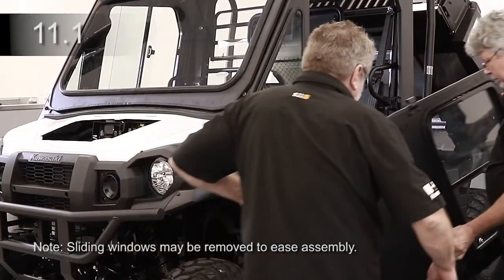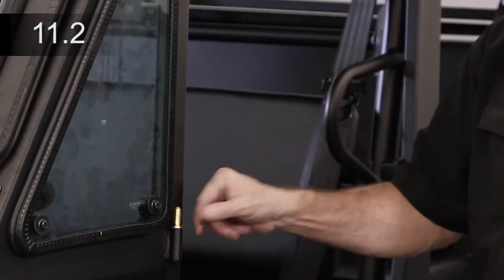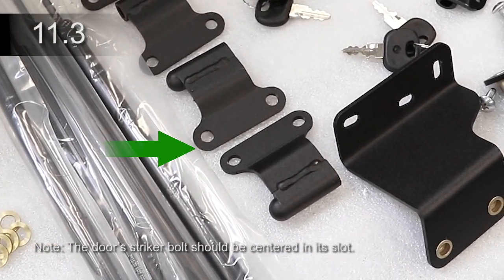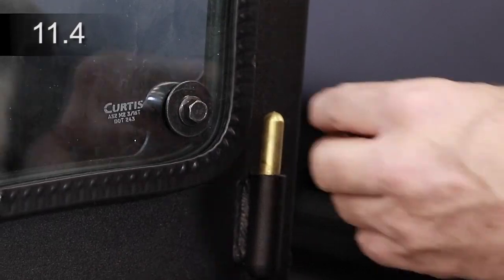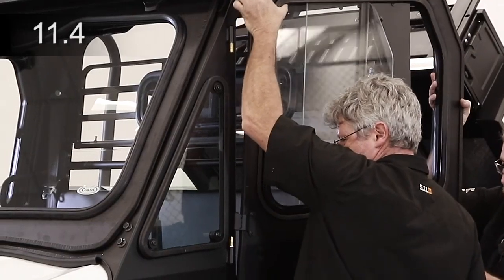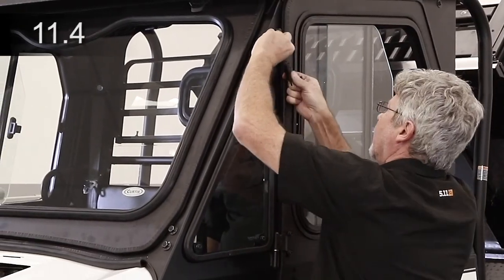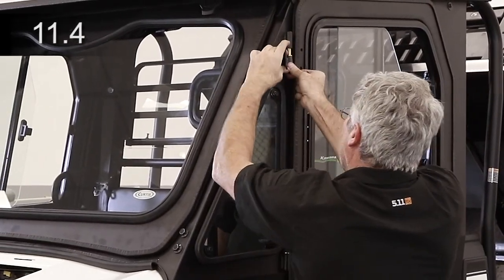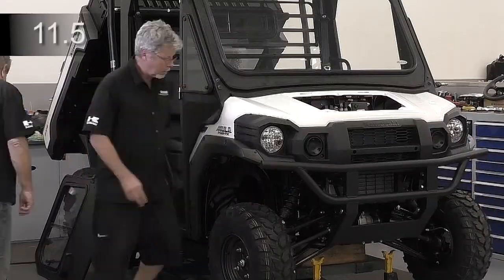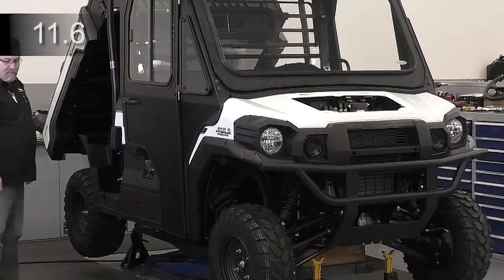The doors are packaged with the removable sliding windows installed. Apply general purpose grease onto the door hinge pins. The left and right upper hinge sleeves will be found in the hardware box. Install a brass washer to the lower hinge of the driver's side A-pillar. Place the door onto the lower hinge and latch. Install a brass washer and the upper hinge sleeve, then bolt the left hinge sleeve to the door. Doors should yield two audible clicks when shut. See the manual for adjustments. Repeat for the passenger door.